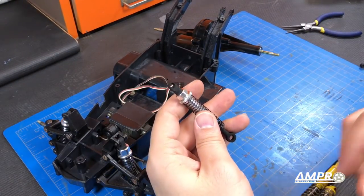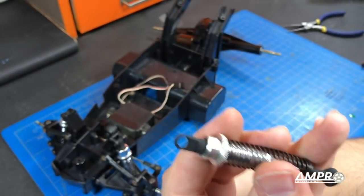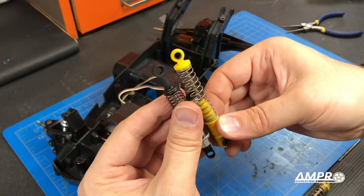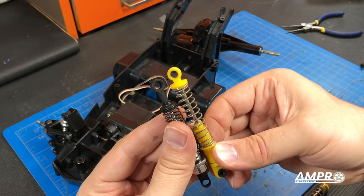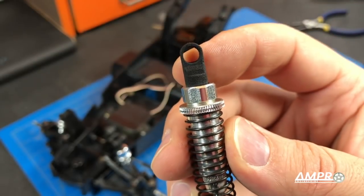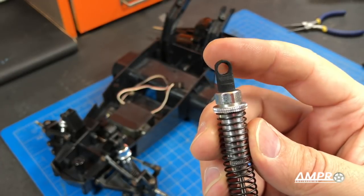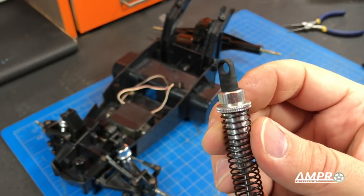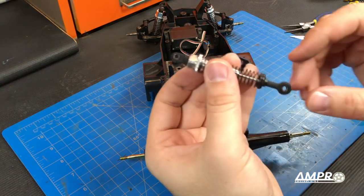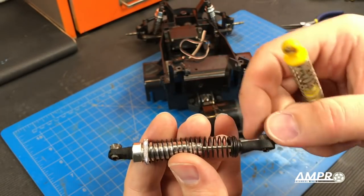At this point, I did change the back shock. You can see that the top eyelet is much, much different, and the bottom is also much different. I had to make this a lot longer because the factory shock absorber is quite long — it's maybe off by a couple of millimeters, but I really wanted to limit some of the exaggerated dimensions. This top piece has walls about a millimeter thick, and I would never produce and sell something like this because it's simply not going to be strong enough for thorough bashing. But on this vehicle it's going to last a million years. I did end up putting these little ball joints in the rear shocks because that's how they were originally done with the yellow ones, so I popped these out and put them in here.